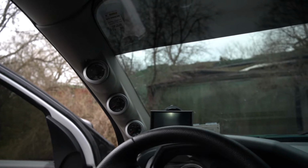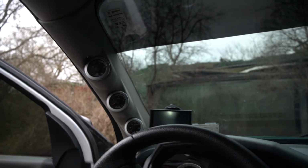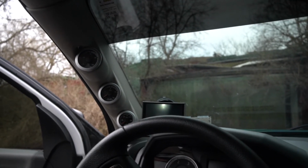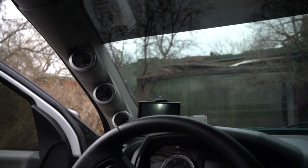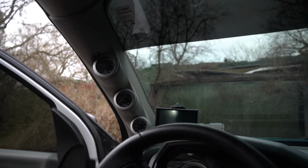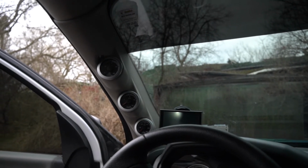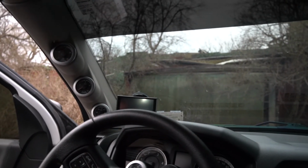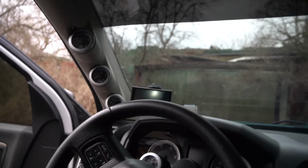I took some time on that wiring harness and I did all of my red power wires separately, then did the orange wires for the dimmer separately, and then the black for the ground separately. I soldered them all, I heat shrunk them, and then I combined them all and I heat shrunk them all together into one. So I was fairly confident that it wasn't in the wiring harness, like wires weren't making contact and touching themselves and giving me this issue. But then again, I wasn't so sure and I didn't really know, but I am relieved that I don't have to pull all this stuff back off and pull the wiring harness out to check everything over.